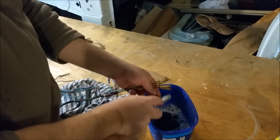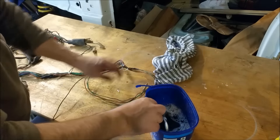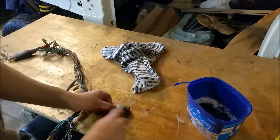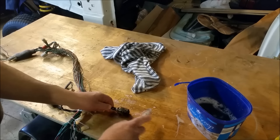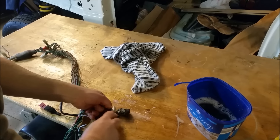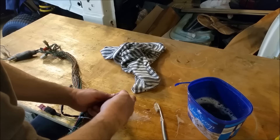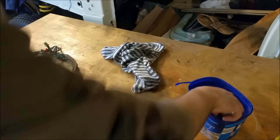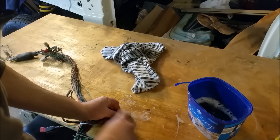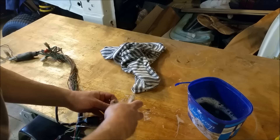The problem with this sort of thing though is you'll probably find that mud has got up in there. If it's not immaculate, it doesn't matter — it's original. I don't want to completely rewire because I don't think it's necessary, given that these conductors look to be in rather lovely condition. Block connectors like this are particularly good. That's just mud and of course that just comes straight off, which is what we want. They've been maintained properly, so they're dried out properly and all looking good afterwards.